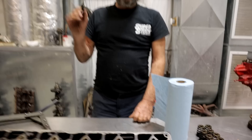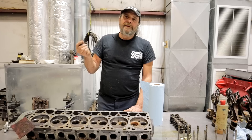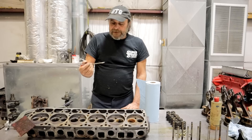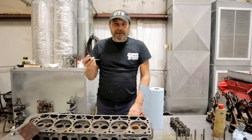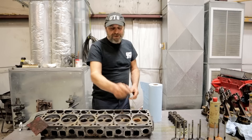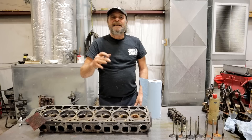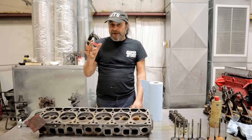There's no hint of a crack at all — it's only discovered when the head is taken apart and cleaned up. Those cracks are inconsequential; they don't spread into a water jacket, they're just stress cracks between that thin area between the seats. Even at that gap of hundredths of an inch it's not going to affect the seat or sealing at all. For myself, I just use it — I know the nature of that crack. Going back to when I first started with nitro cars in the eighties, a hundred percent of the cast-iron Chrysler heads were cracked after the very first run, and guys just kept running them.